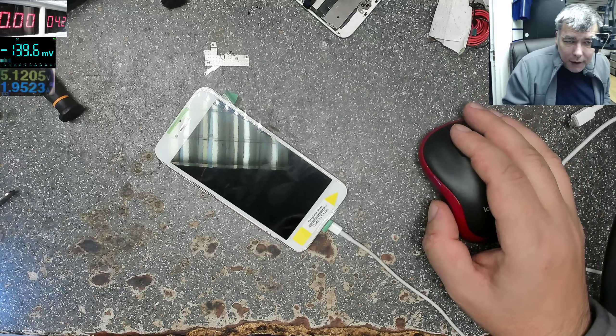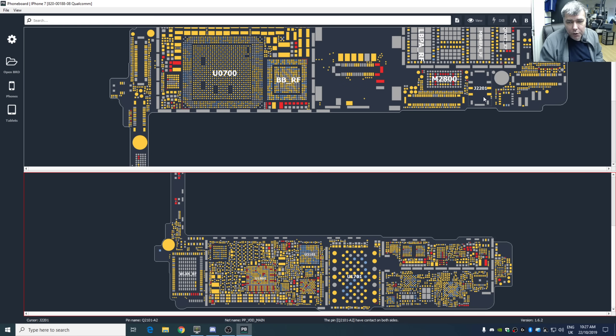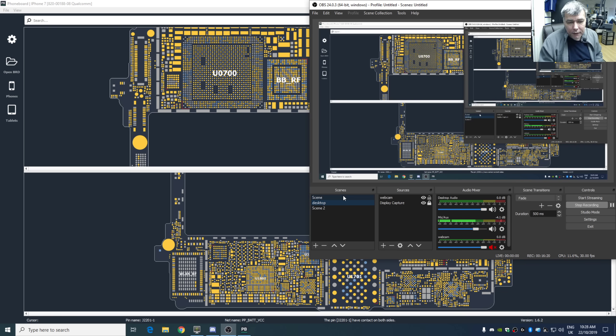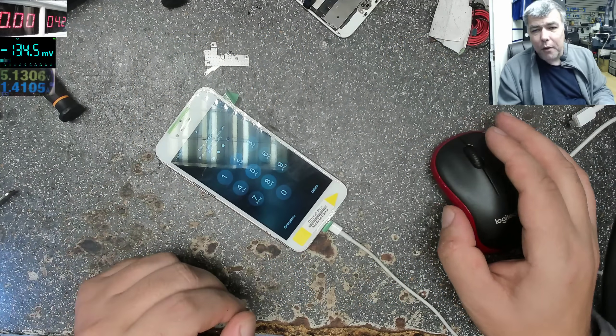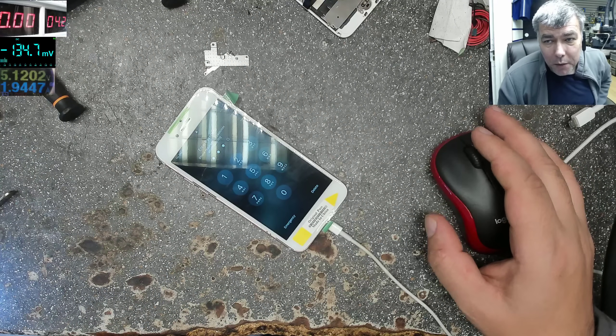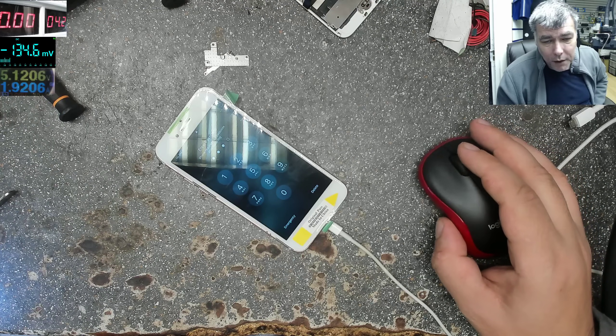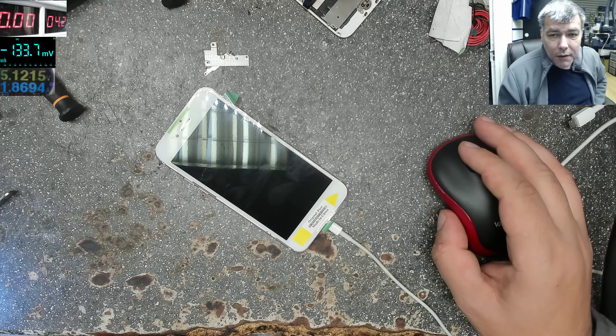On that case, what can be wrong: when you have something that seems like a short but it's actually taking too much power, connected to this power rail is this MOSFET and this chip. Most of the problems are coming from around this chip when it's taking power on this power rail. The phone is fine. That was the problem - which actually was not a short. It was taking too much power: a capacitor which was drawing 1.4 amps. A rare case, but it can happen. Thank you for watching - like and subscribe if you enjoyed the video, and see you on the next one. Bye.